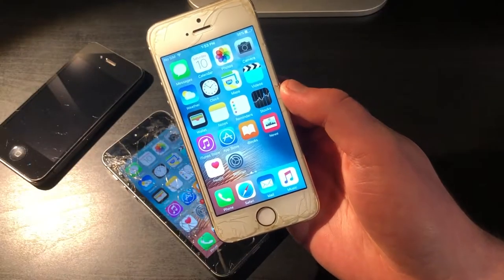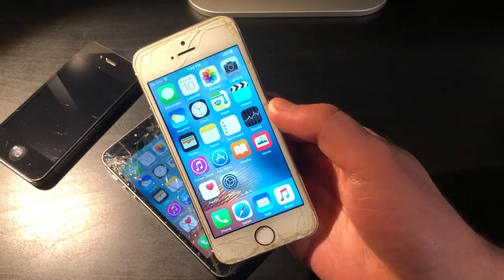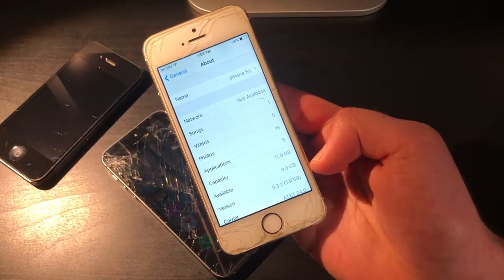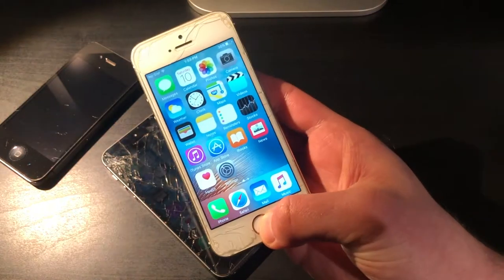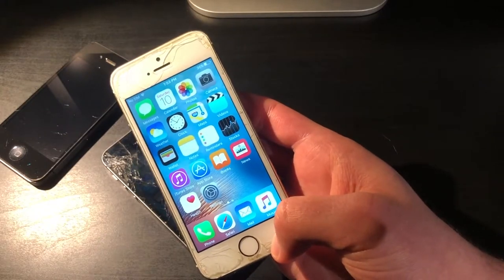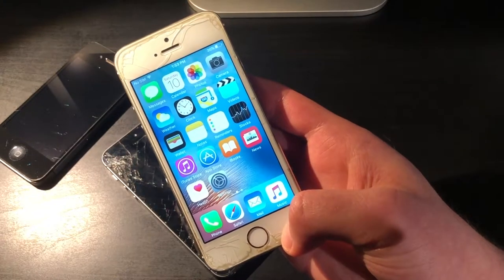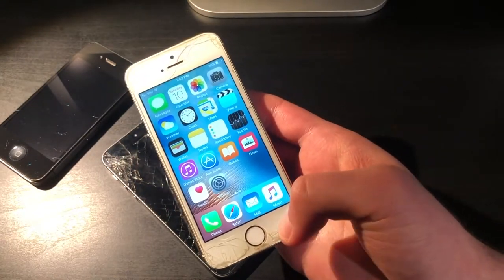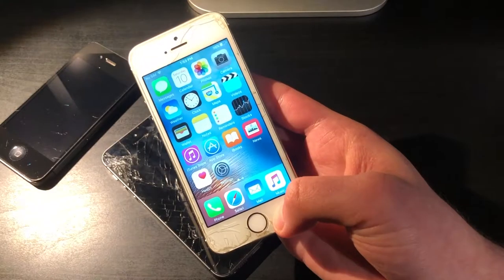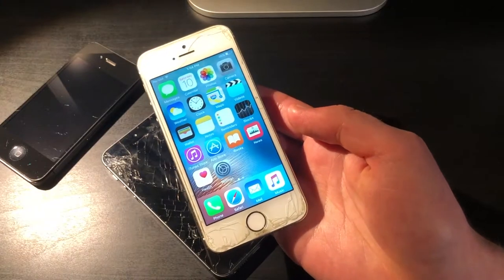Now, even though the time issue on this 5s is pretty hilarious, I believe the problem comes from the iOS 9 activation issues that are common on 64-bit devices. And because this is on version 9.3.2, a later release in which that problem is more common, it could be an interesting situation in which it doesn't ask me to activate, or it doesn't deactivate itself, yet it can't keep track of time properly, because it probably can't communicate with Apple servers properly. So it's stuck in this interesting situation where it works, but it doesn't, but it kind of works. But there's still no point in updating because it's a 5s on iOS 9.3.2.